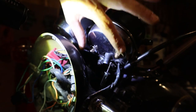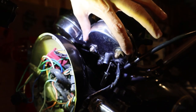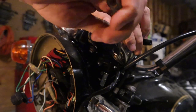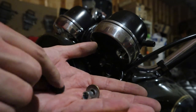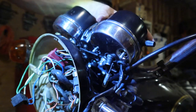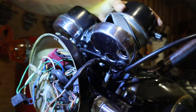The next thing is to remove these two acorn nuts and the speedometer assembly will slip out while the back bezel stays on the bike. I'll use a 10 millimeter wrench to loosen the acorn nuts. After removing the nut, there's a rubber grommet, a bushing, a flat washer, and the nut itself. And there it is — the speedometer is out.